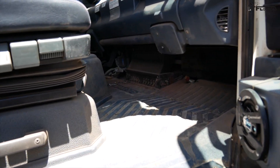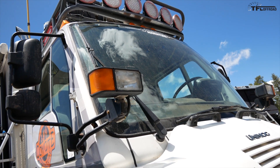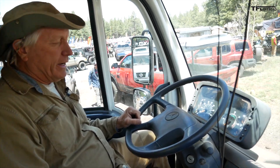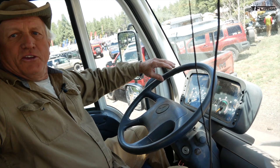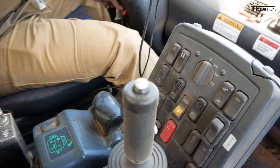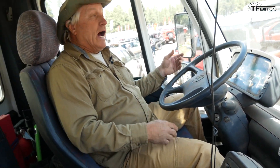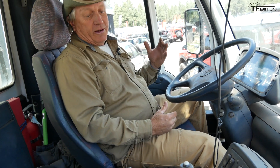Can we look at the inside? I think the interior is fascinating. Welcome to the cockpit. This U500 has what is called a Vario drive — if I push this button, I can pop this plastic panel off and slide the steering wheel and pedal assembly over to the other side of the vehicle, so you can drive it from the right side or the left side. I can pull this lever and the clutch pedal will pop out or fold away. I can run it as an automatic transmission, a manual transmission, automatic with manual shift, or manual with automatic shift — and all the variables therein. Very, very universal.